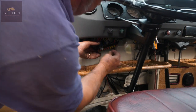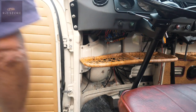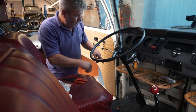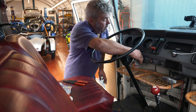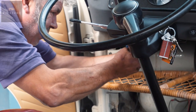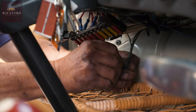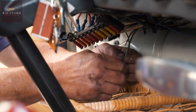Right, so let's disconnect that, get a piece of wire. The first check you want to do — change the fuse. That wire is now completely disconnected going to the back of the car. Ignition on — that doesn't blow the fuse. I'll just repair this quickly. I previously cut this not knowing where it was shorting, so I've just got to repair the wire again.